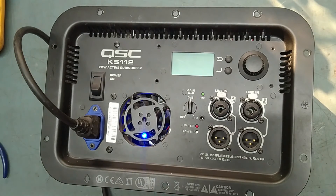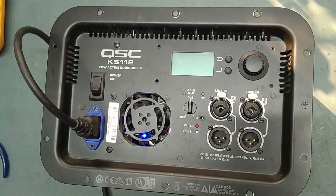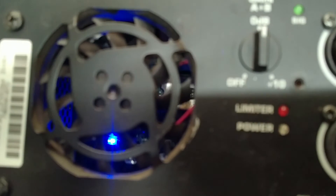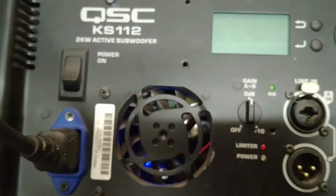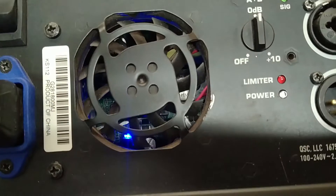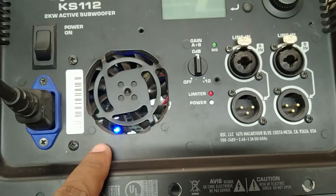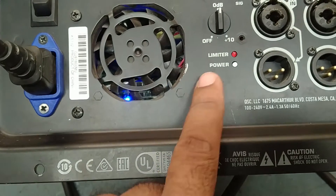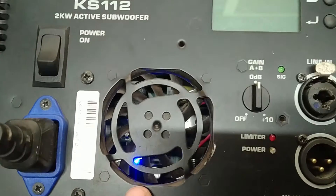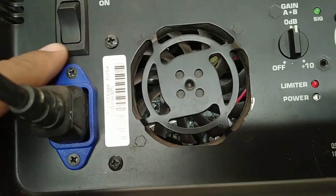I put it on — there is power inside. See, the fan moves and stops. The light is there inside, you can see. But there is no display. Power is there inside, but the power light is also not illuminating over here. The power light should illuminate here, but inside power is there — it means power supply is going inside. We'll put it off and start working on this.